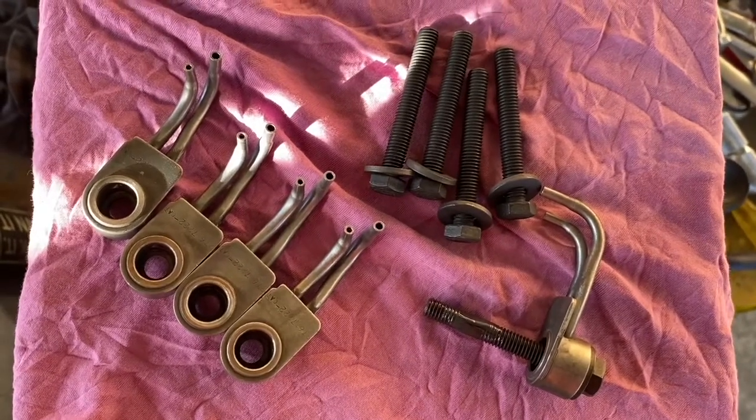In this video we're installing cooling jets in our C11 engine. You need the pistons installed before you do this, and the hole to the left is where your bolt goes through. I'll usually just put it in and try and get it started, and once it's started I'll put it in position and then tighten it by hand.